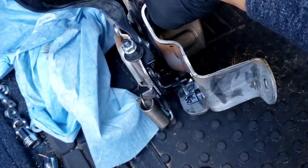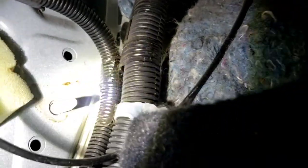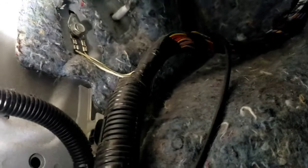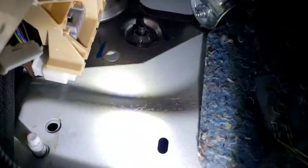Click click — there you go. I'm going to loop the cable back on, put all the panels back on and check it again. Here's the position of the three bolts: one on the bottom, one all the way on top, and one to the left underneath the wiring harness — that's the hardest one to get to because of the wiring harnesses and how close it is to some modules. One, two, and three.